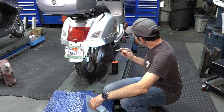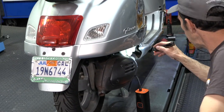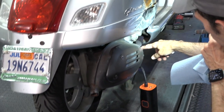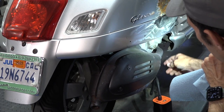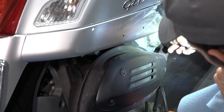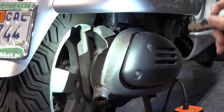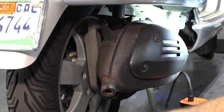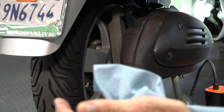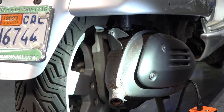While you're at it, make some visual inspections. This is your water pump cover on a GTS — make sure there's no coolant weeping from the hole that's hidden right above where the header is. The muffler's cold right now but there's a weep hole. If you see any coolant residue on the muffler that's a telltale sign. Same with the hose clamps — check all this stuff. Know what looks normal and be in the habit of always checking it. Make sure all three fasteners hold the muffler in place.